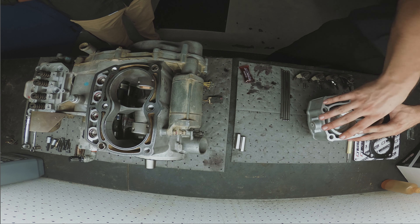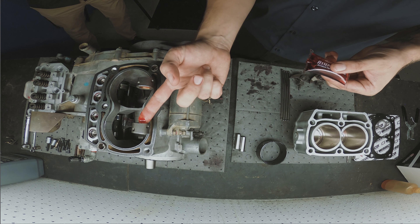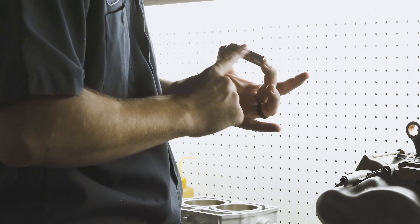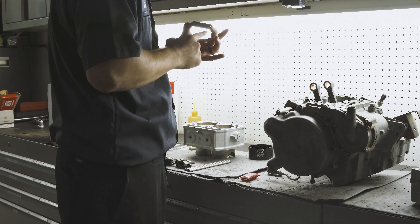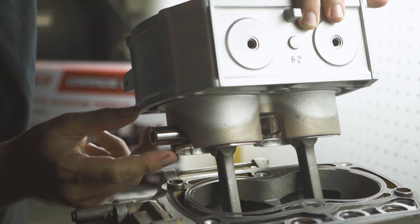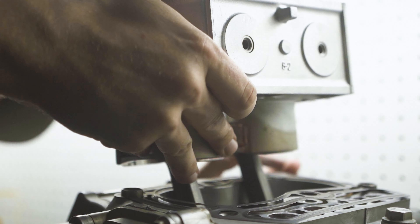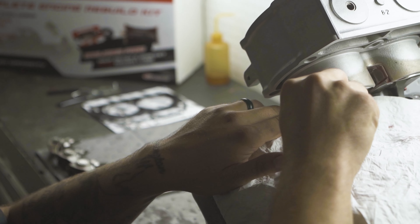As you're installing your pistons, make sure they are going in the correct direction. Applying the supplied assembly lube to the rods provides extra security for the wrist pin, and applying it to the pin and pin bores helps prevent premature wear on initial startup. Gently set the pistons down on top of the rods and carefully install the wrist pin, watching not to damage the brass inserts in the small end of the rods. Use a rag or paper towel to cover the crankcase as you install the circlips to avoid any accidents of a circlip falling down into the case.